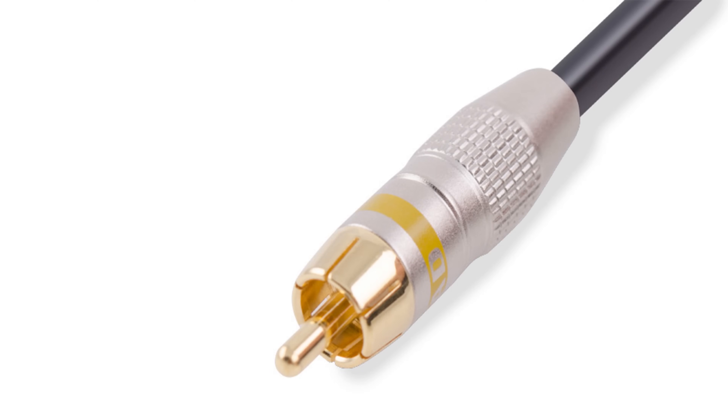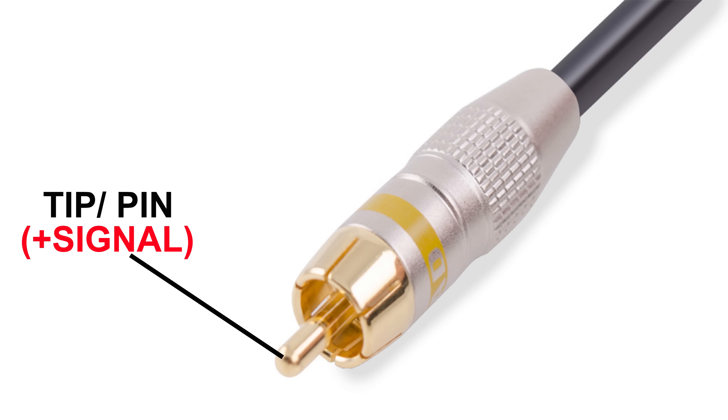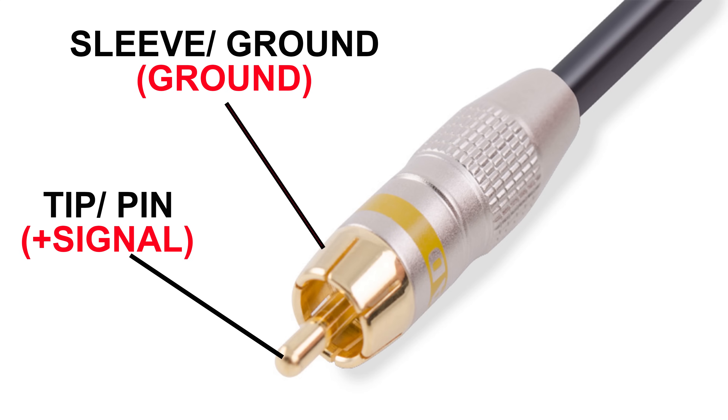If you take a look at an RCA cable, you'll see there is a pin in the center of the cable — this is the signal wire. It carries your audio from one end of the cable to the other. The outer ring here is the ground. This is basically a shield that will keep interference from getting to the signal and causing unwanted noise like buzzing or humming. Cheaper cables will have less shielding and they'll be more prone to getting noise and interference. So if you've got a rack full of poorly shielded cables, they could potentially pick up noise from each other or from any other kind of radio frequency and even your own home theater equipment. Keep in mind that any kind of cable can act as an antenna, which can draw all kinds of noise to it. So be sure to pick up some high quality cables.